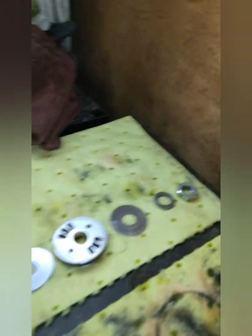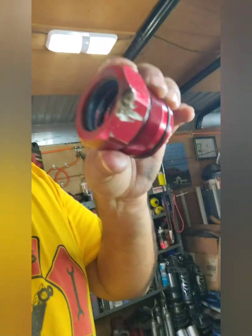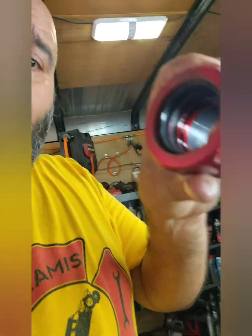The shaft assembly is taken apart. There's the shaft, the valving — rebound piston, compression spacer, and then another internal spacer, and here is where the majority of valving is. There are three seals: one is like the main cap seal that blocks out large particulate, then there's a pressure seal behind it, and then just an o-ring. Externally there are two o-rings.